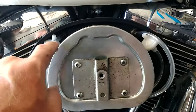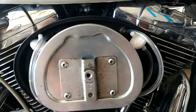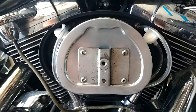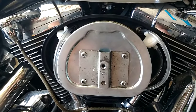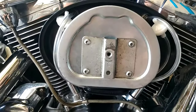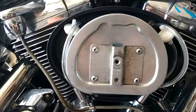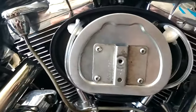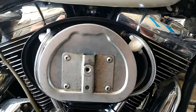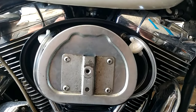The point of this — the cooling I talked about — it's not excessive. It just cools enough to convert to a liquid. I think that hot air rerouted will still satisfy your intake air temperature sensor, if it even recognizes the difference of having eliminated those crankcase gases.